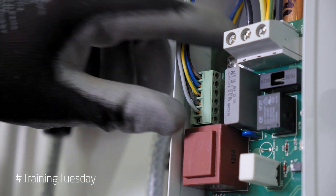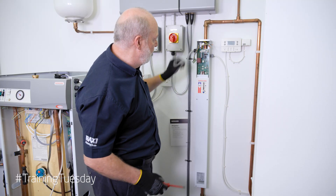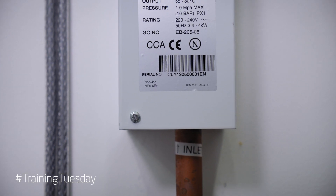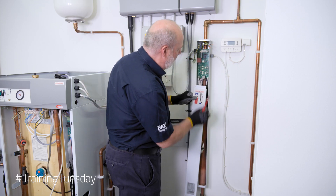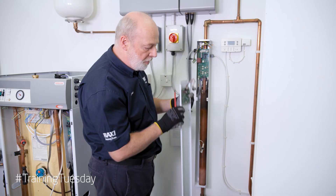Main cable's off, pull the plug — that's our pump live and thermostat connection — and we can take the bottom panel off now with just three screws. Slowly take the panel off because we need to pull our connection off for our small control board on the front.